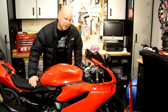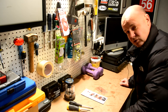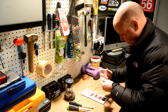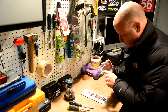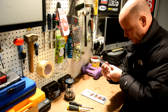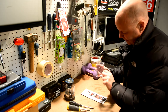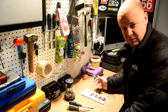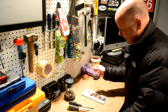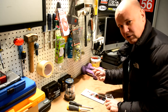So stick around, stay tuned and I'll show you all about the Panigale Spacer Kit and how to install it. Before we get into the actual install, let's show you the kit itself. It's something you get from eBay from some enterprising seller. It's very very simple — there's just this little tri-point bit, like a Phillips but with three bits, a special tool you need for the housing on the throttle, and then these two little tiny red bits of plastic that are going to take that bit of slack out. I bought it from the US and I think it was $38, so about 25 quid. Somebody's making good money, but if it's as good as everybody says then everybody wins.